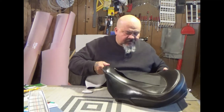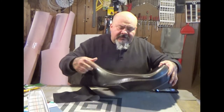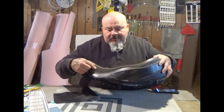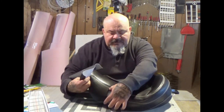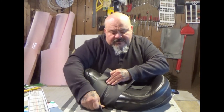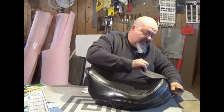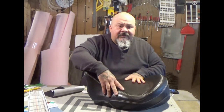For instance, on this motorcycle seat, when I'm pulling down and trying to tuck it under to rivet it to the bottom, I want this to stretch this way — I don't need it to stretch the other way. This piece, where it's sewn on, I want it to stretch down so I can pull it tight to rivet it under. This piece will stretch up, this piece will stretch down, and this piece stretches this way to give you a nice tight fit on the front. It all works together to form the seat when you're done.